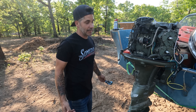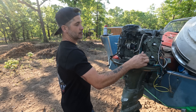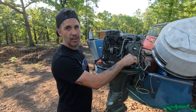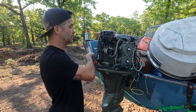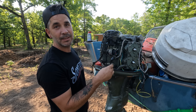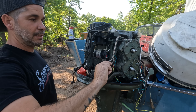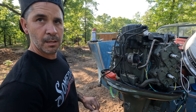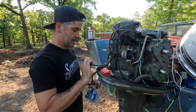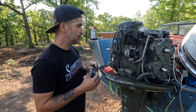So it could have potentially been the wrong kind - different kind, I don't know. I bought spark plugs - these are the old ones, actually J6J, and I got J4s, so I think wrong spark plugs. Plus this one's broken. I need to go to our other boat - the engine's almost the same - and steal some of these. I thought we didn't pick up the spark plugs yet? I ordered them but I don't have them here.